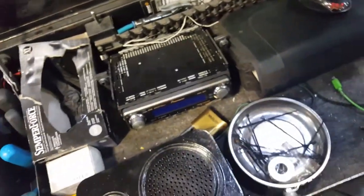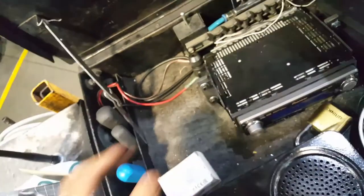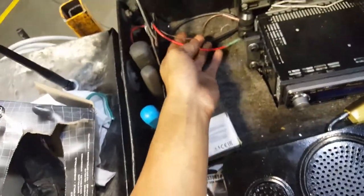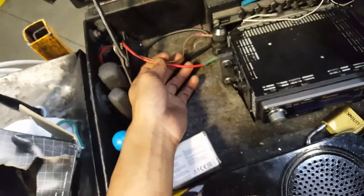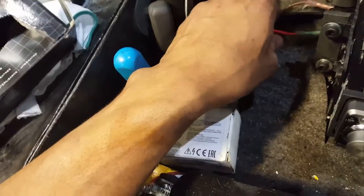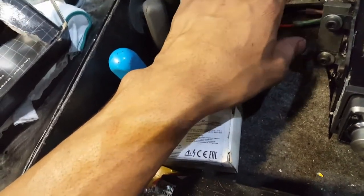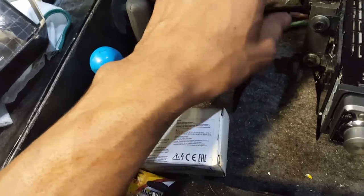What I'm going to do next is I ordered a 12-volt to 24-volt step-up. I'm going to hook that step-up regulator to the 12 volts I got over here — I'll splice off. This is my 12 volts coming in from the power box to the stereo. I'll splice that and run my step-up to that, that way I can test sensors and everything while I'm at work on the go.